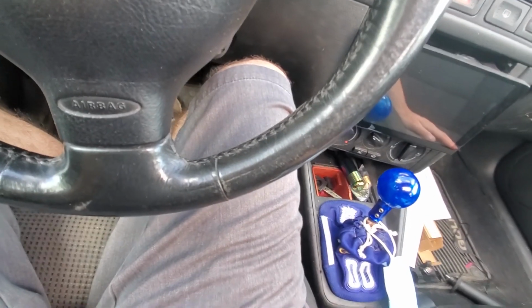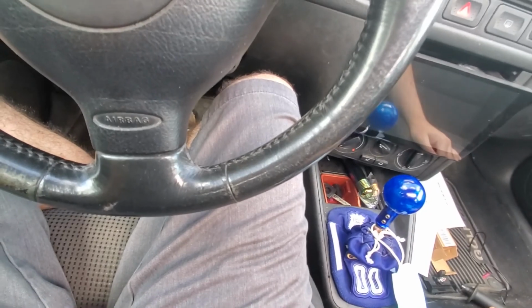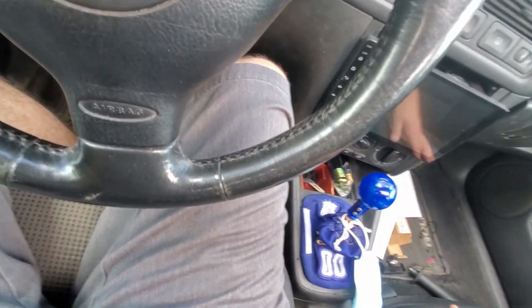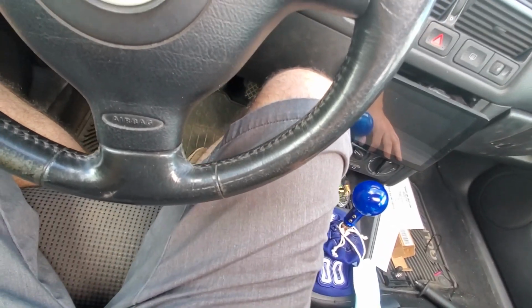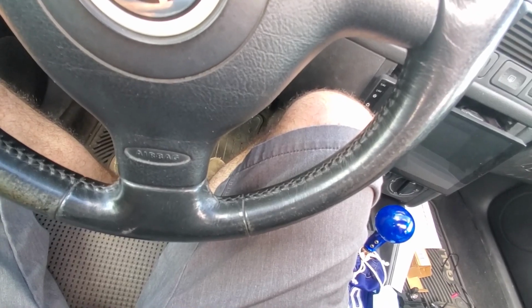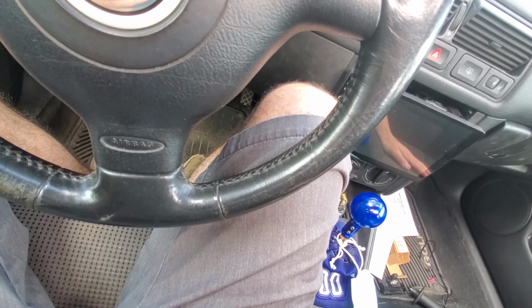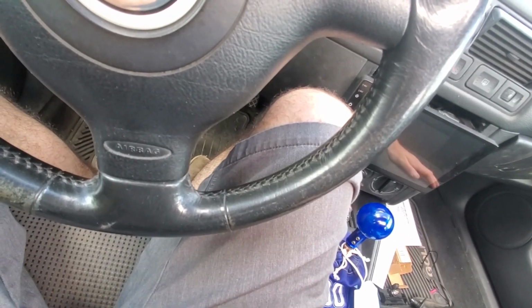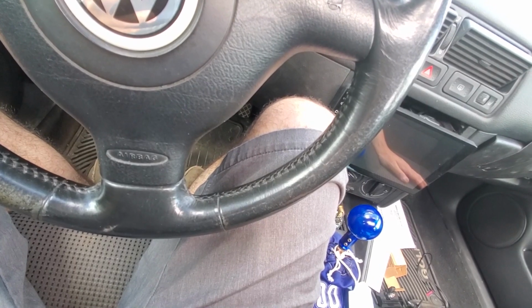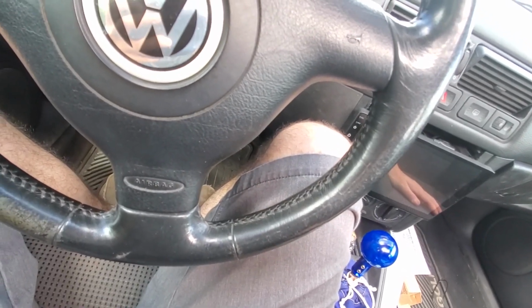It's definitely worth it. It took me a lot longer because I was alone and I had to order other parts, but if you're doing this for your car, make sure you have everything that you need the day of. It makes things a lot easier. Like I had to order front top mounts for the shock and the rear, and I had to order 15mm spacers. What else? Yeah, I think that's just the additional extras that I needed to order.